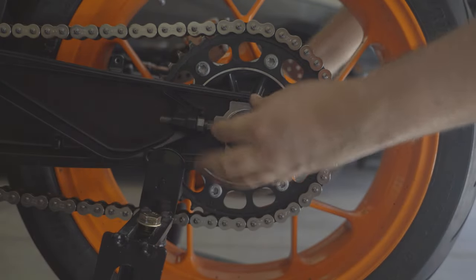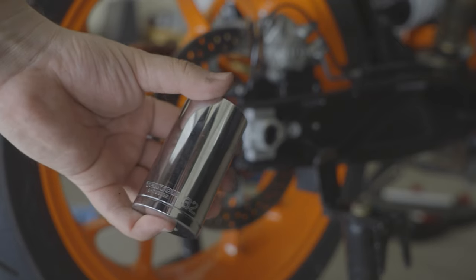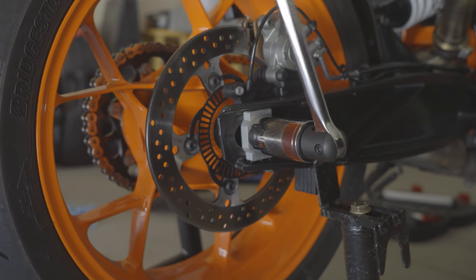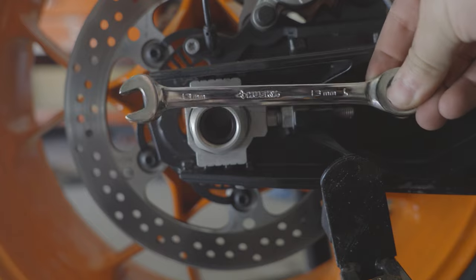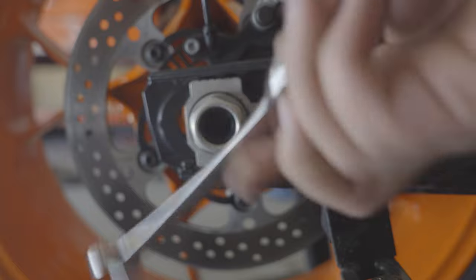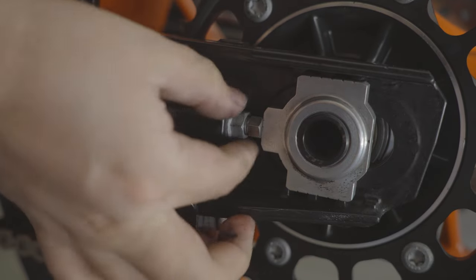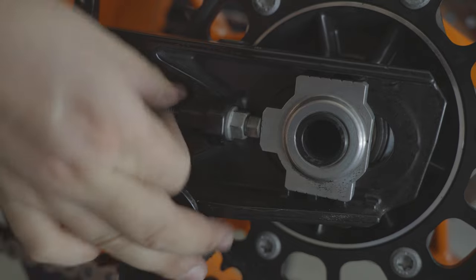In order to adjust that, I'm going to take my axle slider off, grab my 32 millimeter and loosen the rear axle — no need to remove it. What that will do is free up movement within that channel. On either end, we have a 13 millimeter locking nut for the adjustment bolts. Undo the locking nut and that bolt becomes free, and then our axle can slide within that guide.